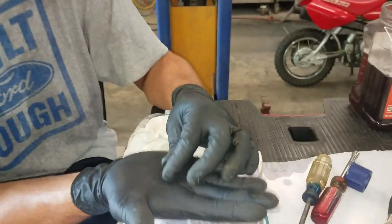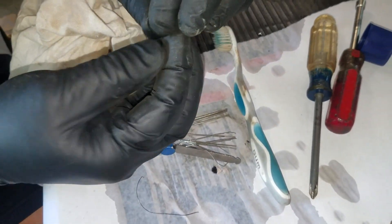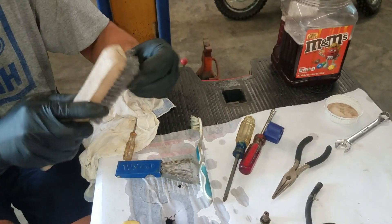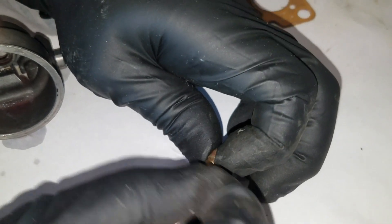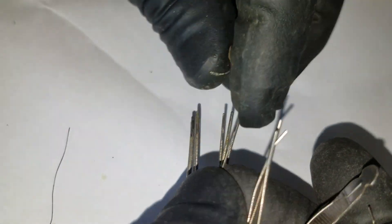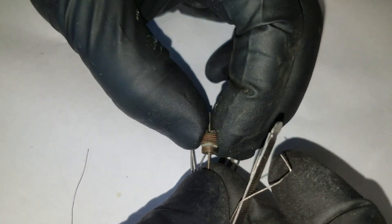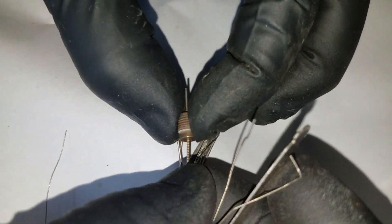The fuel jet — this right here determines how much fuel gets into the engine, that little hole in the bottom. I'm going to do the same thing with it: use a wire brush to make sure there's nothing left over, then just that little wire I pulled out of the steel brush to clean that hole out real good. Word of caution: if you use a tip cleaner, these are designed to actually file as they go in and out. So if you use this, be careful not to go too much because you'll actually resize the jet and your engine will run real rich. Just do a little bit to make sure you got all the crust out.